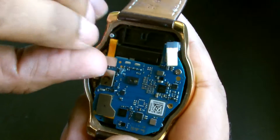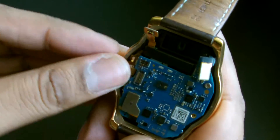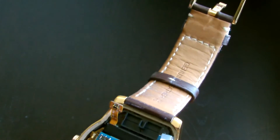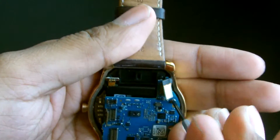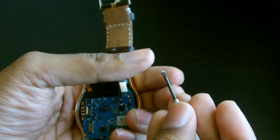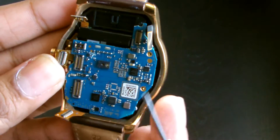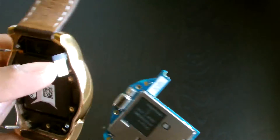Let's say you were changing a battery — you unplug all the clips, the little jumper plugs. Then a couple of screws. The board layout between this watch and the LG G Watch R is 90% the same, with about 10% difference — specifically two screw positions line up fine but one doesn't. You can see I've got the board out: there's the processor and the vibration motor.